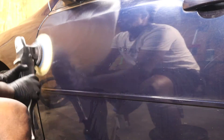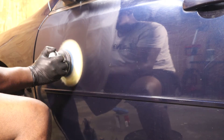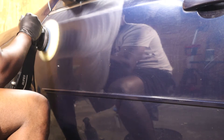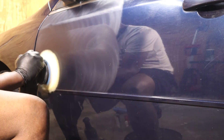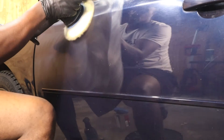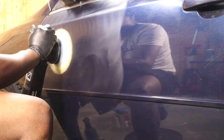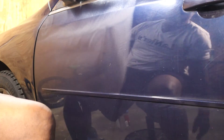I'm going to count the passes as I go. The first pass was just smearing the product. This is just using a polishing pad — I'm not even using a heavy aggressive pad. This is my second pass, and again this is the step you use on the whole entire car. I'm on about my fourth pass. I'm using a Rupes polishing wool foam pad — the wool is backed behind a foam-like material. I'd say that's between five to six passes.